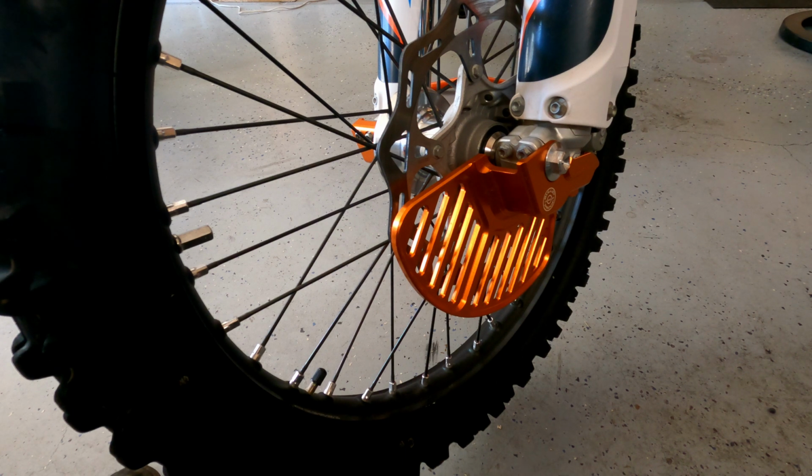But if you can hear the difference between low and high notes and tell if two things are relatively close in pitch, this is a great way to check and make sure the spokes are equal and balanced on a dirt bike without any extra special expensive tools.